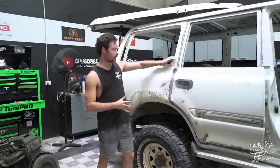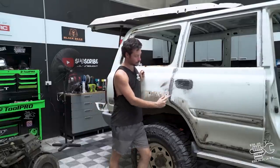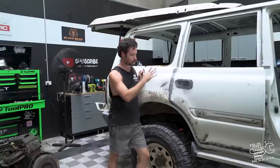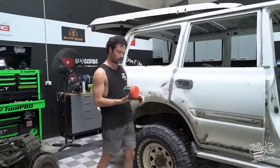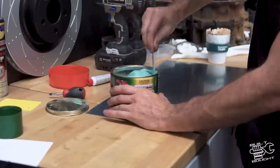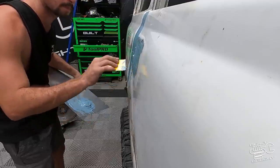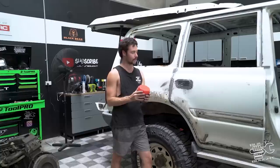We've basically got all the welding up of that back door done. There were two ways to go about it — I went for option B. Fully welding it would risk too much heat and warping in the panels. So I've done a series of tacks letting it cool along the way, then I'm going to use a different product to finish the seam. I found this stuff called Metal Tech Filler at Supercheap — it's basically like a Bondo bog filler but with fiberglass and stainless steel infused, so it has a ton of strength. It really sticks to bare metal and aluminium. I'll run a section of that down to fill the gaps where the rod is, get the base sand done, then finish off with normal body filler.